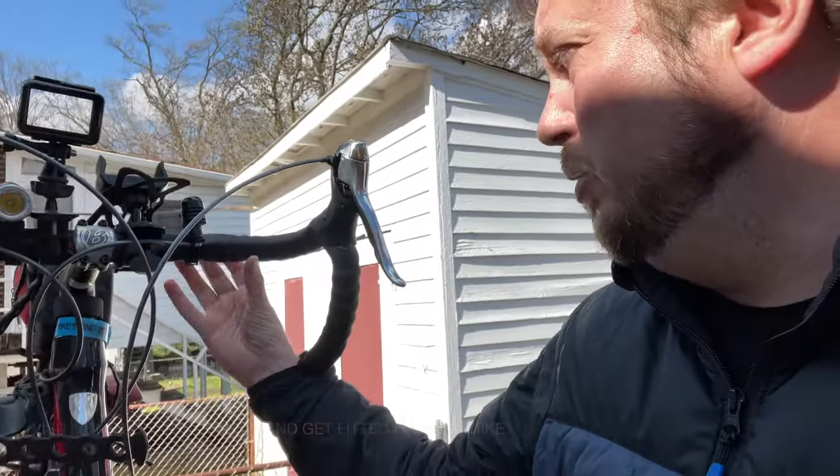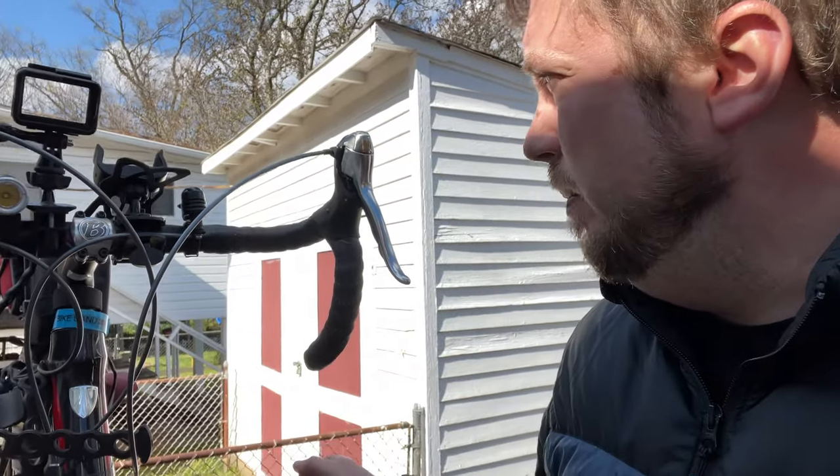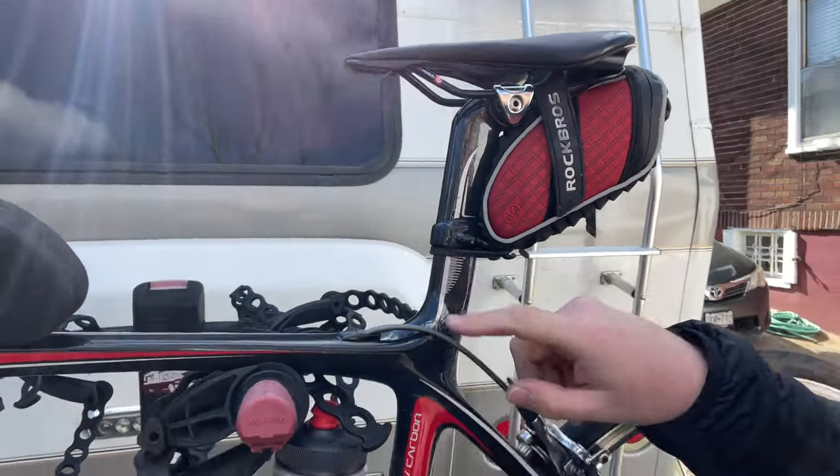So, 101 RAGBRAI. First things first, you've got to have a bike. Let's go outside and take a look at the bike I purchased. You want to get a bike fit to make sure your bike is proportional when you're leaning over on the bars and that your seat's at the right height. You also want to make sure you're getting a frame that is your size. If you're small you want a 50 to 54 centimeter bike. Medium is typically 54 to 58, and anything above 58 is a larger size frame. You can also get bikes that come in small, medium, large, and extra large, like Giant and different brands.